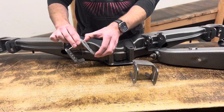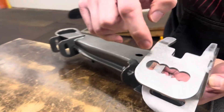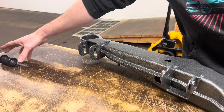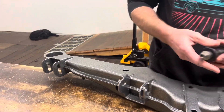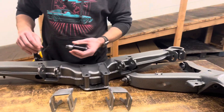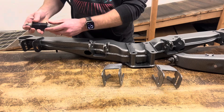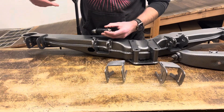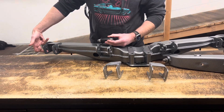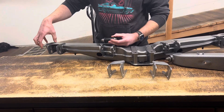You can see here this is slotted, and then this has the four holes. Once you mount this inside the control arm and put the control arm in place, you're going to want to adjust this — it's going to change the angle. That's why the slot is here, and then you have the fixed points on the outside so they'll lock in, so you don't have to worry about it slipping if it was all just a complete slot.